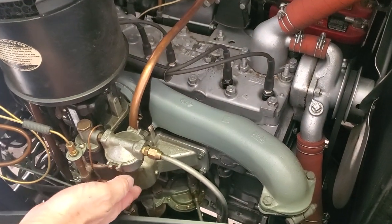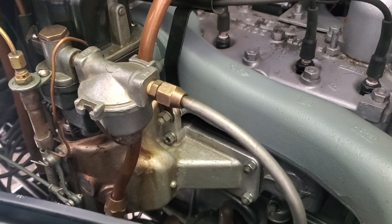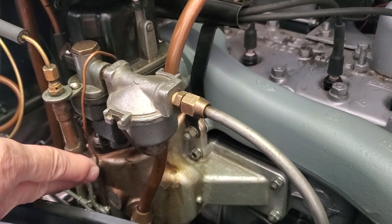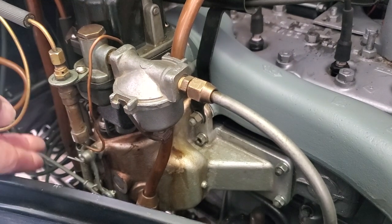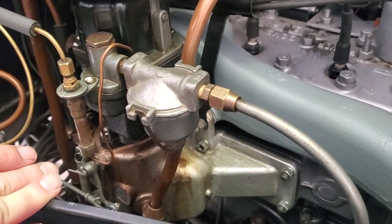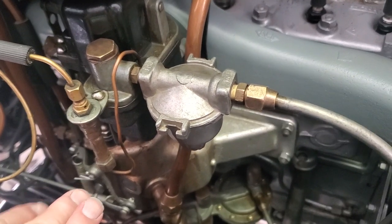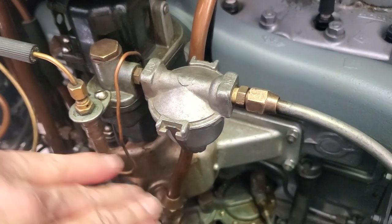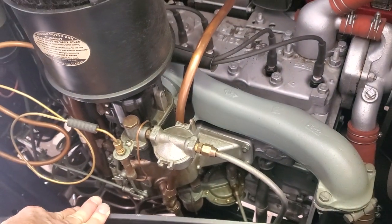Now, why they did this in the 1930s, not only was it sort of a lack of testing, so you're not caring about who your customers are in Arizona, largely because there just aren't enough of them, but the real other thing that most people do not realize is gasoline in the 1930s was not good like we get today. They would have something they called heavy ends, or parts of the gasoline that would not vaporize easily. So they were actually heating the gas up more in order to cause it to vaporize. So this construction of sitting on top of this intake manifold so close to that exhaust manifold, and everything being hot, is actually more a function of the fact that the gasoline in the 1930s wasn't as good as it is today.